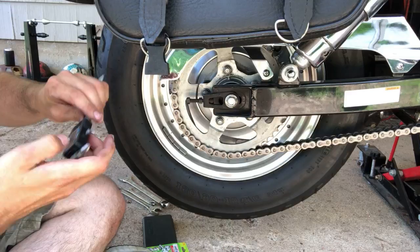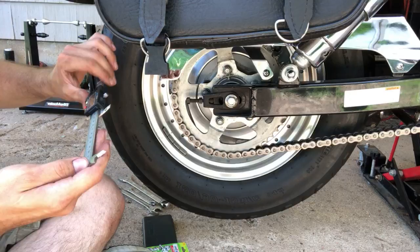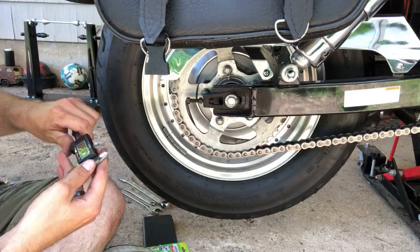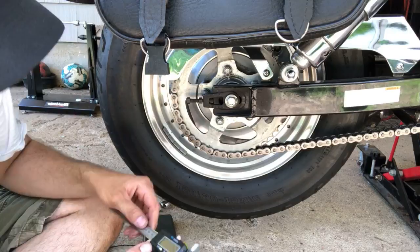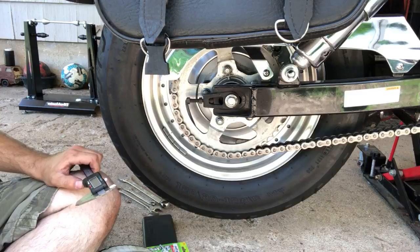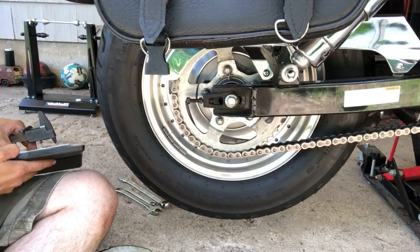Yeah, I guess I'm not gonna build yet. Steal your wife's seat. She'd be sitting right here on my mustache. That's cool. See if we can, I guess, yeah, 12.6 inches isn't going to work when this only goes to 6 inches, huh? Well, darn it. I had a problem all the time. Yeah, 6 inches is enough sometimes. Yeah. Well, and I don't have a tape measure. You're supposed to go and count 21 pins and measure it. On my bike anyways, or this chain, 12.6 inches. If it's more than that, then it needs to be replaced.